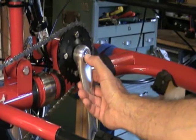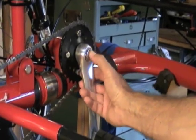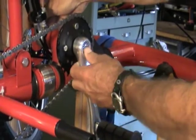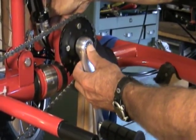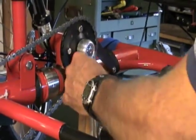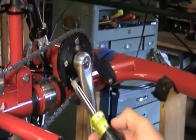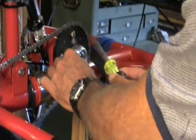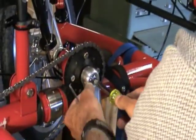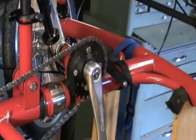You have to be sure that there's free play available. You don't want to turn it in too far or you might not be engaging the shifter properly. You want to be sure that when you click it in, it can still wiggle. Then this keeps the button from turning — this turns the set screw against the end of the threaded rod, and the push button is installed.